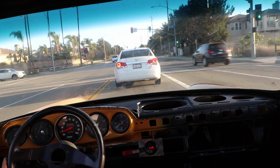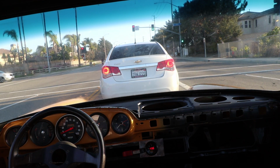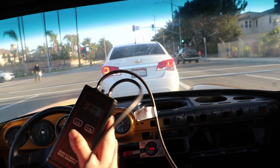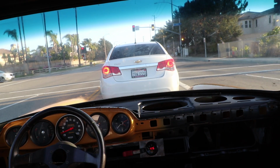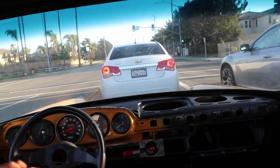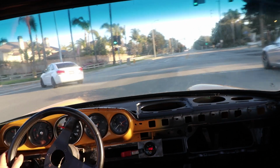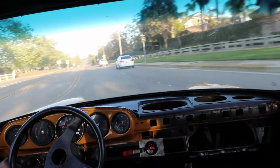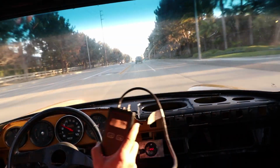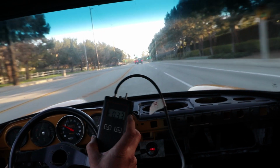We'll do that hill again with one side disconnected to sort of see what the pressures were, because it was fluctuating a little bit, but it looked like it was going from plus to minus. And then at idle, it's just showing 0. I'm not getting much airflow at all. It only measures sort of higher airflows. There could be some pulsation, reversion coming out of the carburetor, and that could affect the pressure. About 0.2 or 0.3, but it does fluctuate quite a bit.